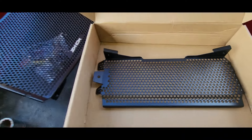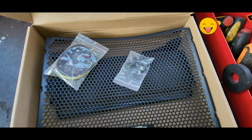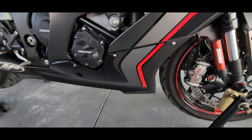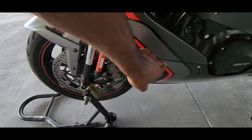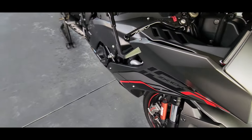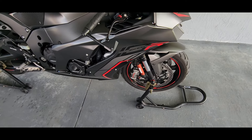I'm going to show you exactly how to install this on your bike so we know what the product looks like from the packaging. I'll also leave a link in the description of this video where you can get these parts. So let's take off the belly pan. To take off the belly pan you're going to need to take off one, two, three, four bolts and then the same thing on the other side — one, two, three, and four — and then the belly pan should come straight down. Then I'll loosen this top one here so I can move it forward away from the bike and just take off the horn bracket.